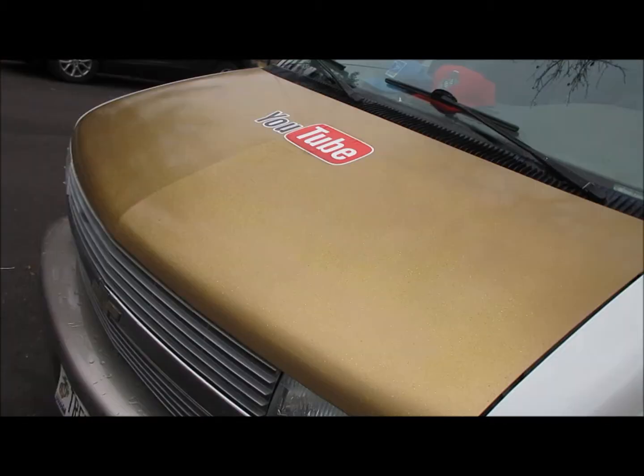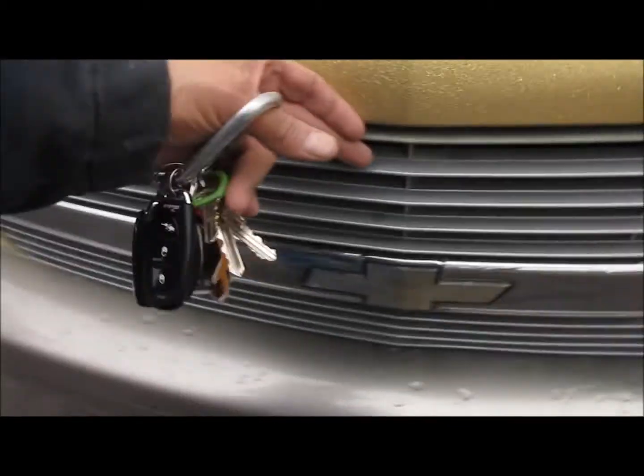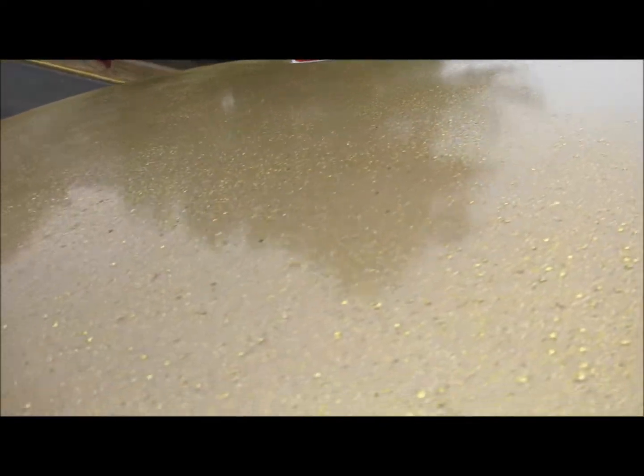Either way, thanks for watching. The only other chance I've got of saving this - I mean it's really not bad, but for me it is. I expected better of myself. Crystal clear, not crystal clear - the only way I could save this is apply a lot of wax, or since this clear is lacquer and the other is probably enamel or acrylic - that's the older way cars were painted versus newer - I could try to top coat with regular car clear, but I'd have to look that up because it might peel. A thicker clear coat would be the only other way to fix it.